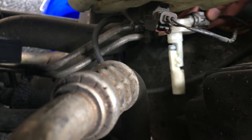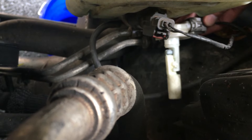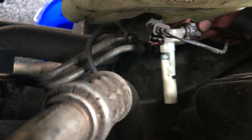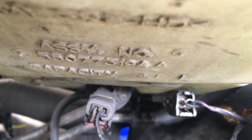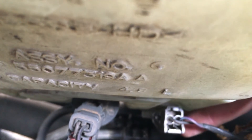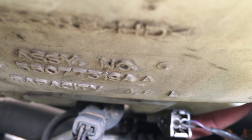You just want to pressure fit it back in. Be careful to make sure that the float is properly oriented when you put it back in, the same as you pulled it out — that way it will function properly. And that's how it should look. Press back in, and just make sure that this connector is oriented upward when you press it in. It's real easy to pull in and out.